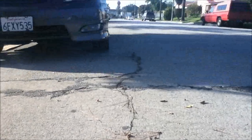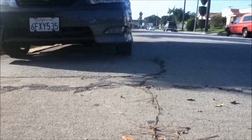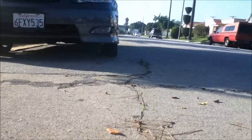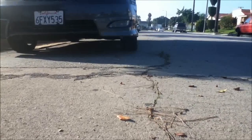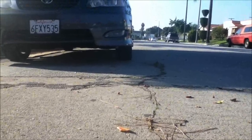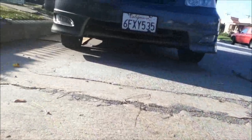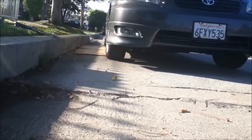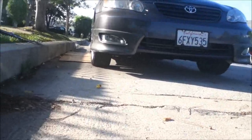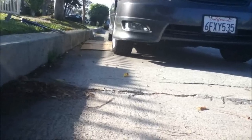Next, you go ahead and take a look at the wheels. It's very hard to see with the camera, but I can sort of see how my front wheel aligns with the back wheel pretty evenly on the driver's side of the car. And just eyeballing it on the other side of the car, this is the passenger side, I can sort of see how that wheel kind of tilts in towards the inside of the car, so it's a little bit toed in. It doesn't quite line up with the back wheel.